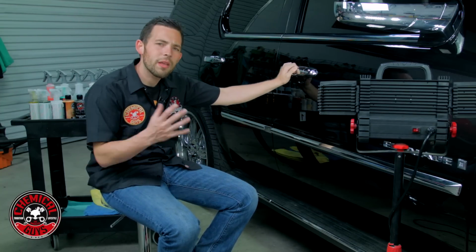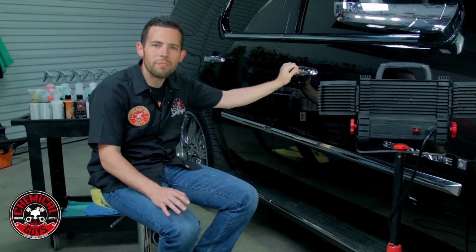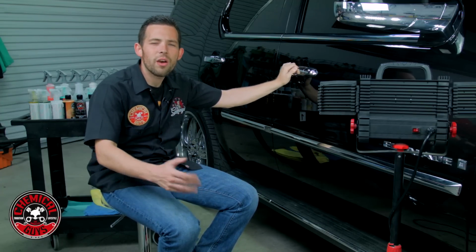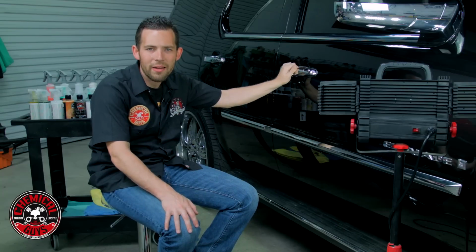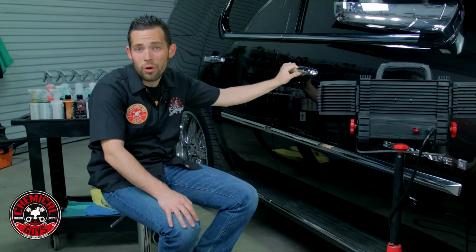and that gave me the best results. Now out of all the products that I used on this video, the best results I got was by using a rotary machine with V32, an orange pad, and then using V36 on a dual action with another orange pad.